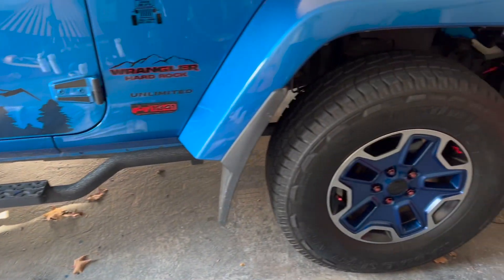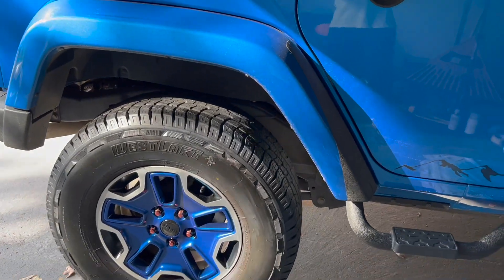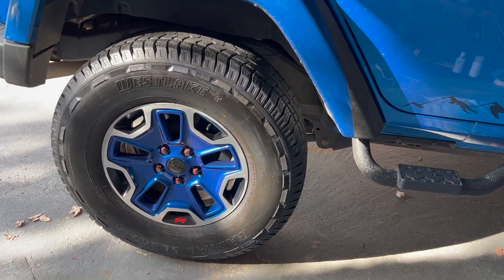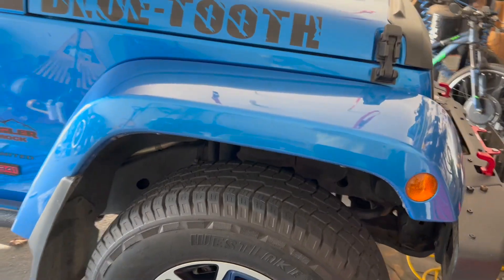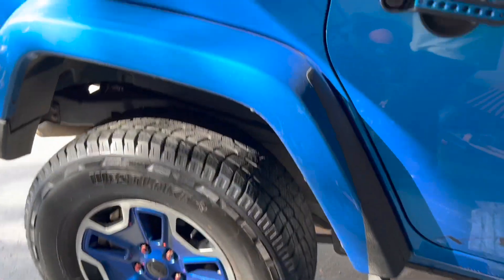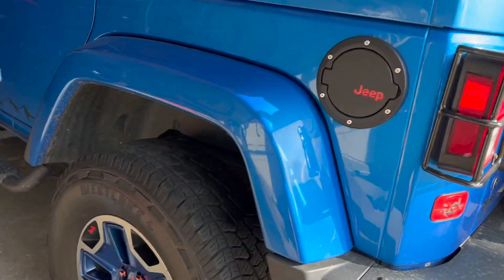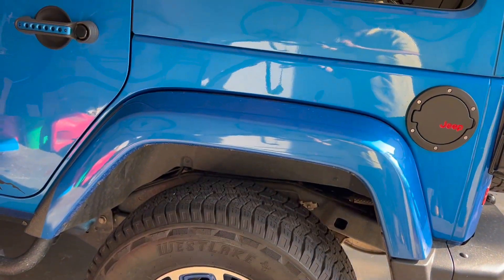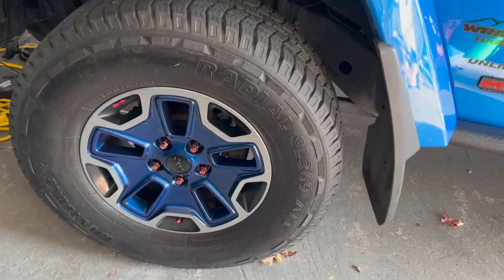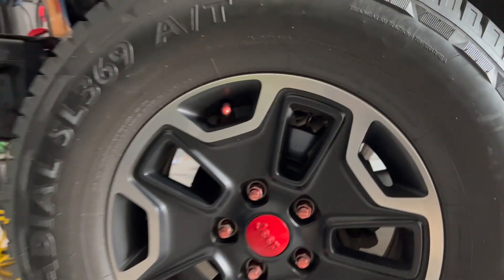We are complete. These are not going to be my permanent wheels — I intend to get better rims next year, so I didn't primer these wheels. If you use a white or gray primer, you would actually get the factory color to match. As you can see, painting on dark came out as a darker blue, but initially this blue is supposed to be the exact factory color. This is still not a bad finish — I don't mind it at all. But if you are interested in matching your exact factory paint, once you get the color code from the dealer, you can find many third parties who produce the factory color. This one I purchased on Amazon. They are done.